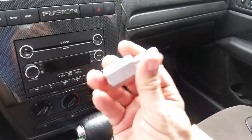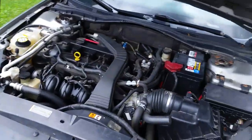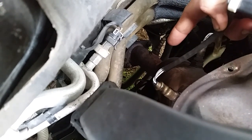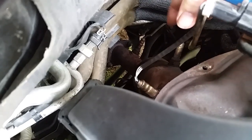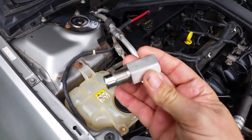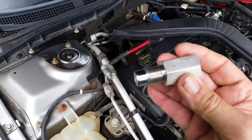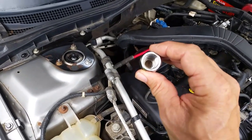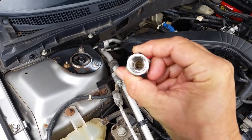Your P0420 - you will have to really get it fixed the right way. States like California and New York. But where I live we don't have emissions. I just want to see if these actually work. If you have an off-road application and you want to put one of these on your vehicle just to keep the check engine light off after putting a high-flow cat on, this actually might be okay. Now in my car it's pretty easy to get to. You can see all three O2 sensors - one before the cat, one in the center of the cat, and one at the very bottom back. That's the one we're going to change out. I should have probably bought two - one in the cat and one at the end. Typically you put these in after the catalytic converter in the very last port.